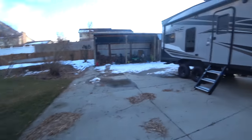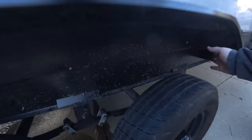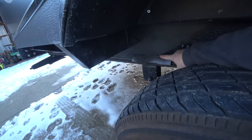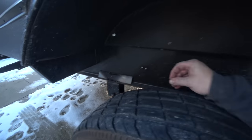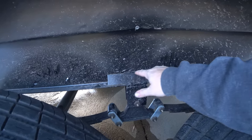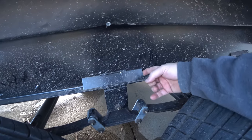The next step is to grind away anything that's not flat. We're going to have to grind away these screws and remove these brackets. I should probably remove them down there too — I've got to remove these gussets. This is actually usually right where it cracks, right where that weld is. So we're going to preempt that.